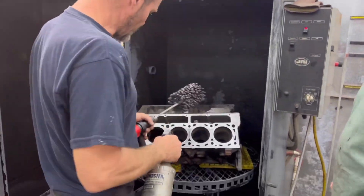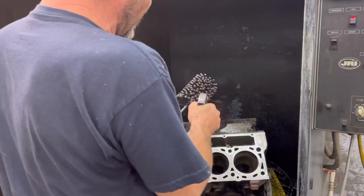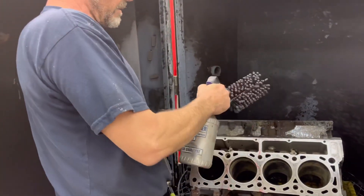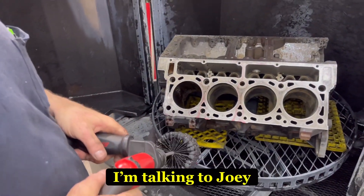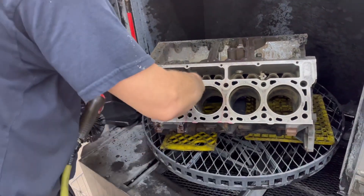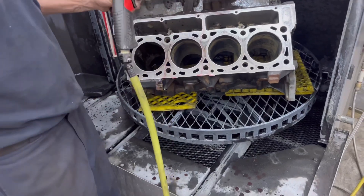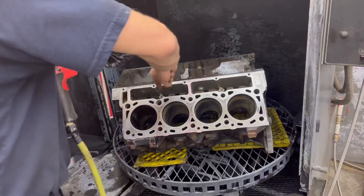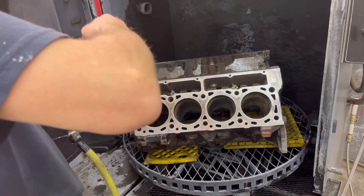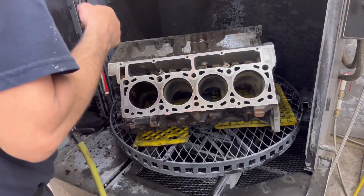You want to know how to ball hone - is that why you're here? You want to know how to do backyard repair? You want a 40, 45 degree angle when you're doing it. The speed is pretty good - we'll set the speed, just remember how fast that is. You got to do the stroke so that when you come up, this thing spins on a little less than a 45 degree. If you see a 45, don't go more than 45 - then you're going too fast.